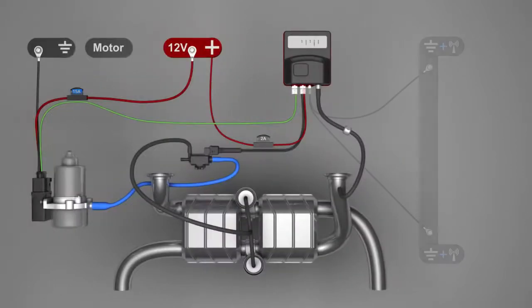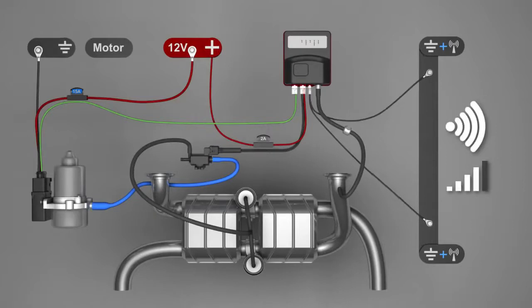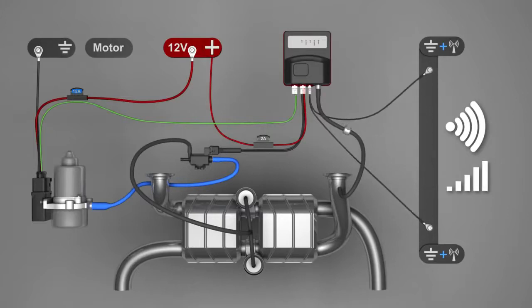Thirdly, the ends of the two antenna cables must be fixed as far apart as possible to a grounded metal element. They then resemble a ring antenna. The smaller the distance of the two cable ends is, the weaker the transmission power of the CES3 becomes. When the car radio does not receive an RDS signal, the distance between the cable ends must be increased. At the same time, these antenna cables are also the ground wires for the power supply.